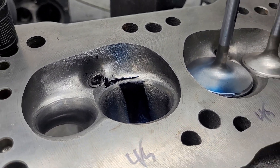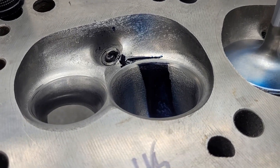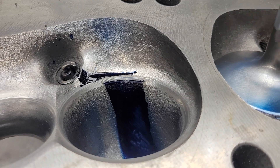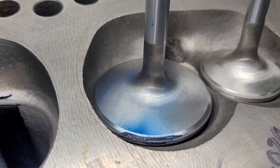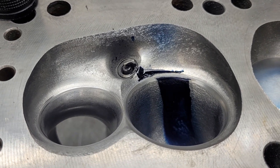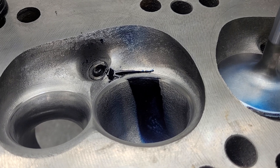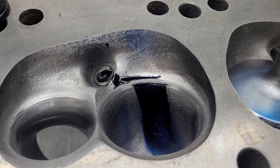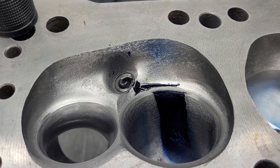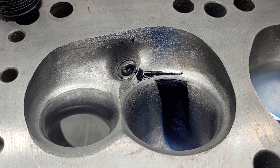Hopefully this is the last time you have to look at these — the 769 W2s. I think I've got them to the point where we can call it quits. I put a little dykem through it, not as much as usual because it's really light, but I like what I see. The intake valve got a back cut; I lapped them both. They're good as far as concentricity. As for Brett beating me — Brett does a really nice job, I've seen his work. The only thing I didn't agree on is he has a rough texture on his short-side radius and I have a polished radius. Other than that, the work was pretty similar.